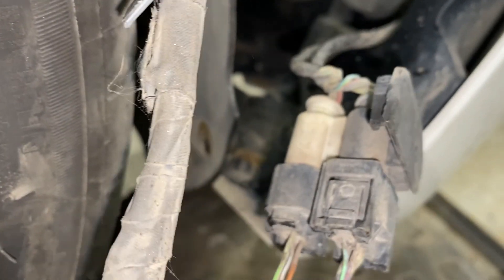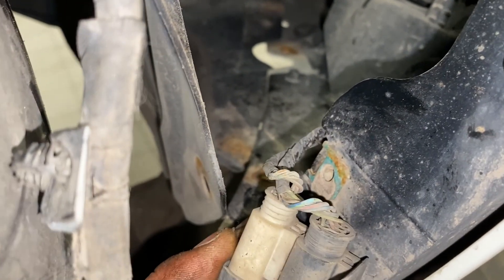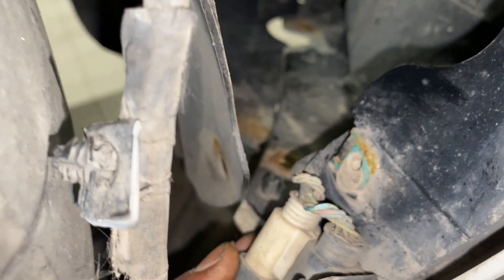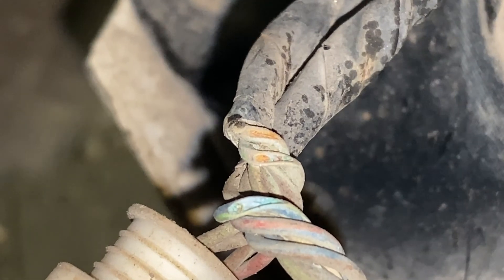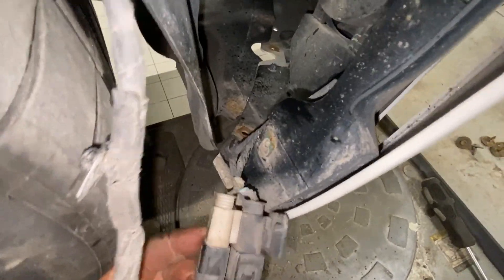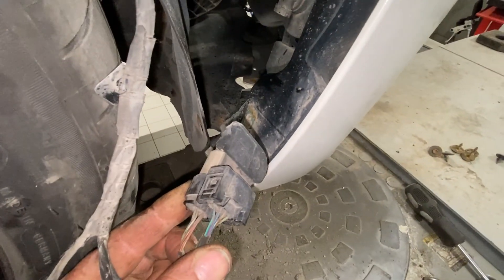You can't really tell by looking, but I can just do this. Found it already! I love it when I find problems. It's not the CAN wire, but look at that one — it's absolutely skanky. That might be one of the parking sensors that aren't working. There are two faults on this job, and one of them is the parking sensor. It looks damaged and it's been rubbing. Oh my god, there's even more wires. This is the problem — people don't do the job right, they route the wires wrong and it starts chafing, purely because someone couldn't be bothered to fix this. What they've snapped off has now caused a massive wiring fault.